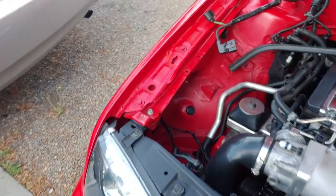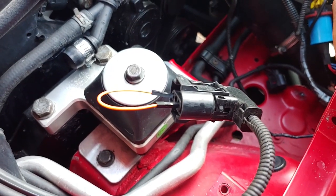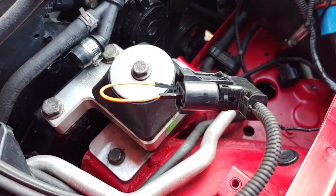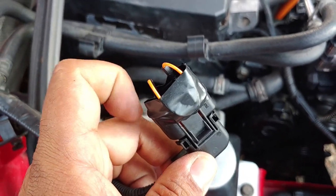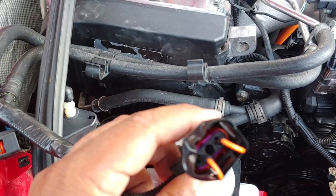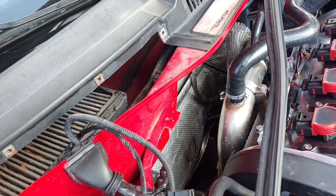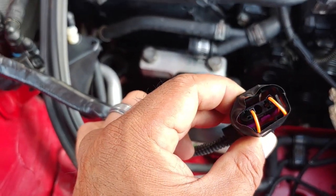So we're going to go right over here and do one at a time. You guys can see right there, we jumped the wire just like that. For these to stay in place, you're going to fold the wire over and electrical tape it around. You'll see how we electrical taped it in a circle, and now we're going to go over it. The reason we're doing this is to prevent moisture as much as we can from building up inside of here, since we're going to be putting it inside the rain tray underneath here — just to keep as much condensation out of this as possible.